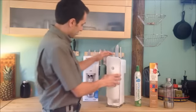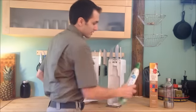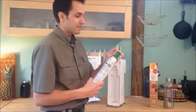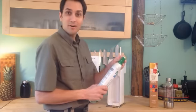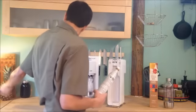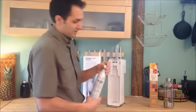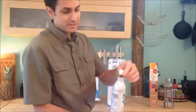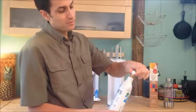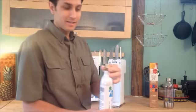Put the cover back on the back. So now we're going to install our CO2 bottle. This is the gas that makes the water fizzy. So you take off this plastic cover and you'll see there's a little plastic cover on top — you guys see that? So we're going to take that off too. Be real careful with the top of this bottle; you don't want to bang it against anything.